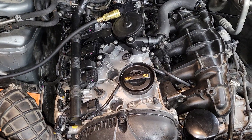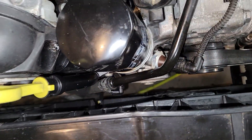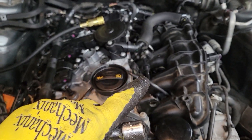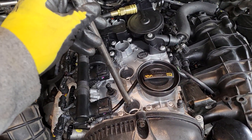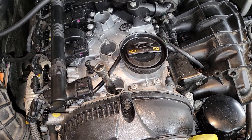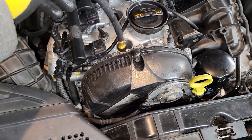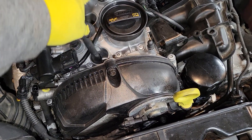There are timing marks on the crank pulley — a little arrow on the crank housing and some notches on the crank pulley that you line up. You want to verify that by making sure the piston is at top dead center. With those alignment marks at the bottom lined up, this will be at top dead center on the compression stroke. Then take your air supply fitting and put it in the spark plug hole.